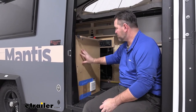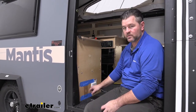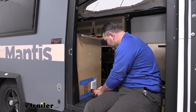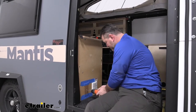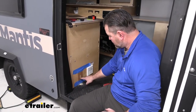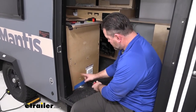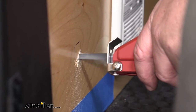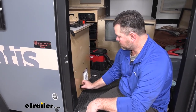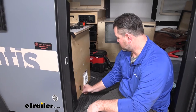Now because this cabinet is pretty nice — brand new camper — we don't want to chip it as much as we can, so I'm going to start with a pilot hole in the center, gradually go up to a bigger one, and then take a saw and cut that square out. Make sure before you do anything you check behind it to make sure there's nothing back there that you're going to damage. Once I drill my hole in the center, I went ahead and outlined the mark. I'm going to take a saw and cut out that square. Once you have your hole cut, go ahead and test fit your switch — I would not suggest pushing it all the way in. It's easier to run your wire through, wire to the back of the switch, and then push it in. Do any trimming you need to make sure it's going to go in.